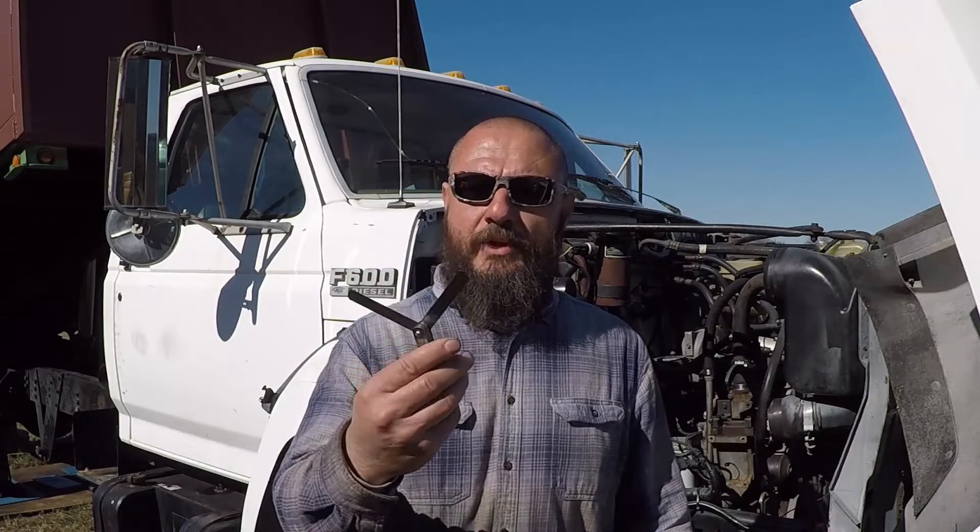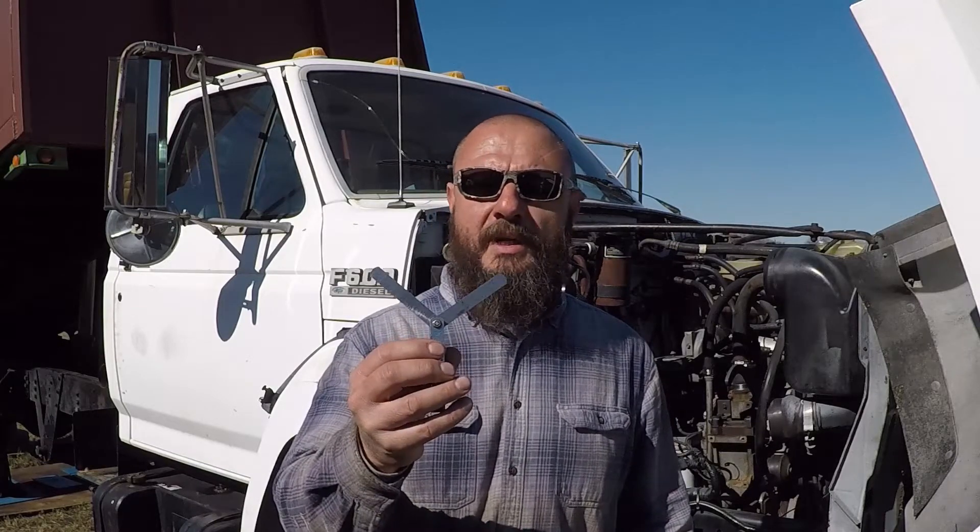Hello YouTube. In this video I'll show you how to set the valve lash clearance for any type of engine. In this case I'm working with the Cummins 5.9 litre 12-valve diesel engine, but you could apply the same information for any type of engine, gasoline or diesel. The valve lash clearance has a big effect on the performance of the engine, and it's really cheap — it doesn't cost much. You just need to make sure to clean the engine so you don't get any contaminants when you open the engine cover, and you need one of these feeler gauges. If you buy it online it's probably less than 10 bucks.